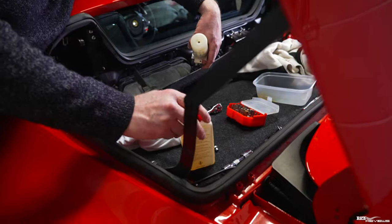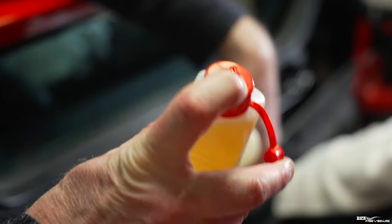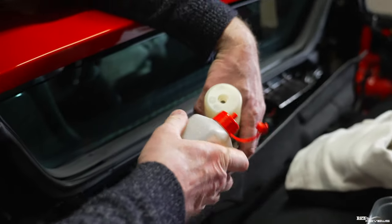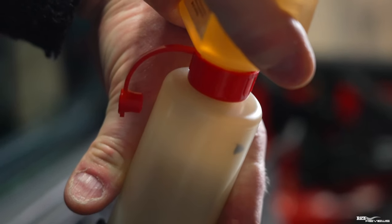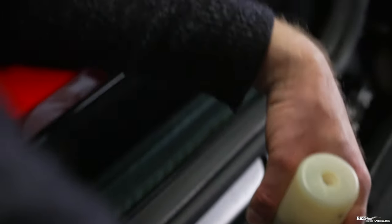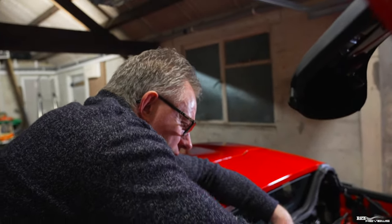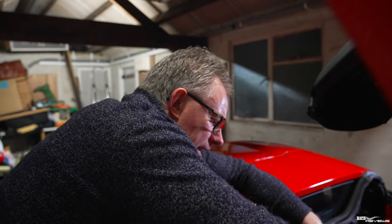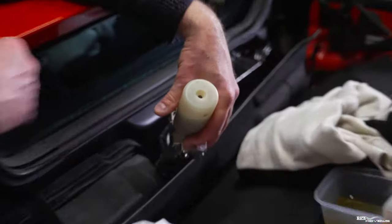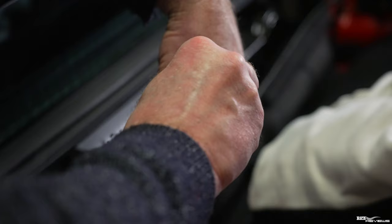This is 25 centilitres so that should be about right, and I've just cut off the end to enable the oil to press into the reservoir. You don't want to get too overzealous and put too much in there, because you're not looking to fill the reservoir completely. You need the right amount of fluid to enable the hydraulic system to function properly, but leave a substantial air gap for fluid to come back into the reservoir when cycling.